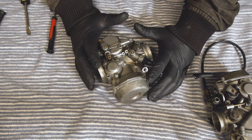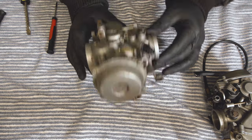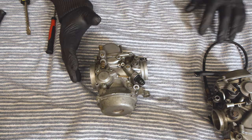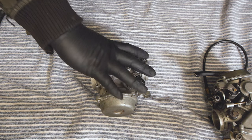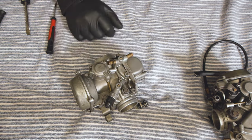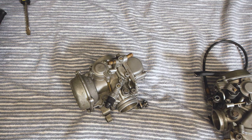So let's get them on the bench and I'll show you how to disassemble them. This is not going to be a complete breakdown of the carburettors — this is going to be a quick 'how to get it working again' kind of video. If your bike's been sat for a long time, chances are it's clogged on the inside, meaning there's gunk and crustiness inside the float bowl. Your jets are most likely going to be blocked and your bike inevitably is not going to run.